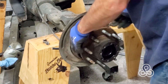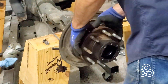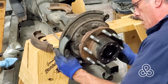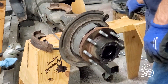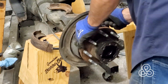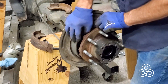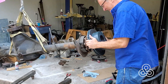When I got this axle it came without any brakes, so having the convenience of brakes out of the way I decided to put some new brake shoes on for the emergency brake. Any brake job is just a matter of taking it apart and putting it back together with new parts. These brake shoes just clip onto the expander at the bottom that the cable pulls on, and then there's a little adjuster spring at the top that holds them together, plus a couple of retainers in the back. Emergency brake shoes are on.